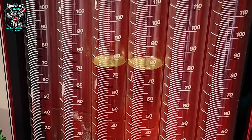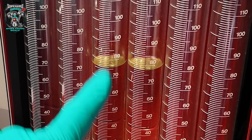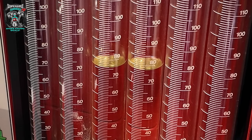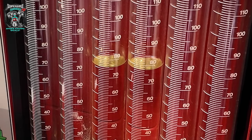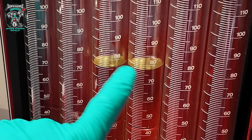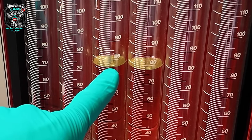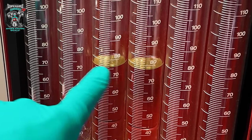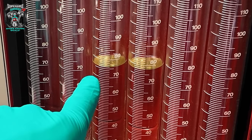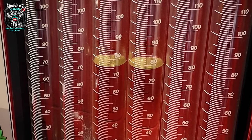I'd need to look back at the video footage to see what the others were producing. I might test the old injectors back-to-back with these and just see what they're flowing, keeping the pressure setting the same, since tiny differences in pressure will affect the reading. But yeah, I'm stuck really.